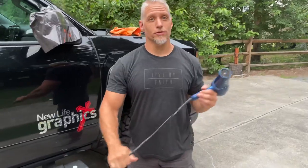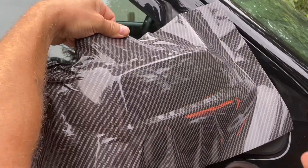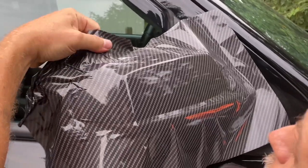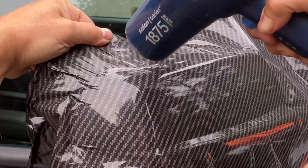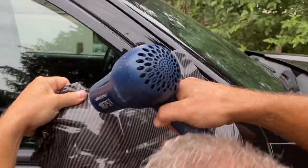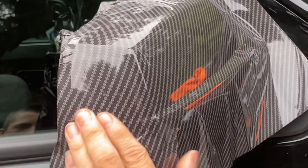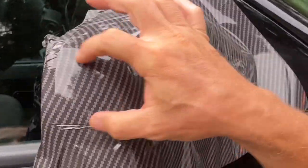Now if you absolutely need to, I realize some of you might not have a heat gun — a heat gun is optimal, the best thing to use. But you have your girlfriend's or your wife's blow dryer, and that's going to throw off enough heat just to get this material to conform. Take it, make sure it's going hot. Get it nice and hot, get it stretchy. Now that it's stretchy, look at that — it lays just like paint. See that wrinkle right there? Boom, and it's out. Lay it down, take your thumb down, run it over, and look how that side — look how all that looks real smooth, just like paint. It's just that easy.